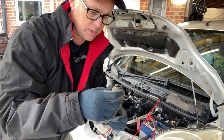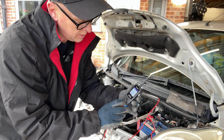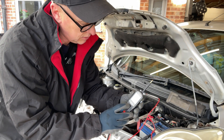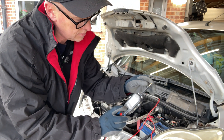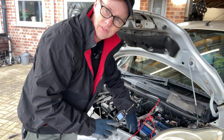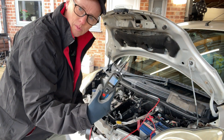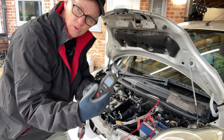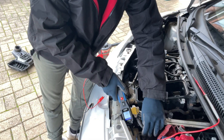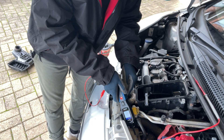It comes with its power probe - you shove that in the end of there. It becomes a power probe: if we just put it onto the voltage setting and press down on that one, it gives us continuity to earth, and if we press it up it gives us battery voltage at the tip. So we can power up devices on the car. It's got a built-in fuse that will reconnect itself if it gets overloaded - it'll just cut off and then reconnect.